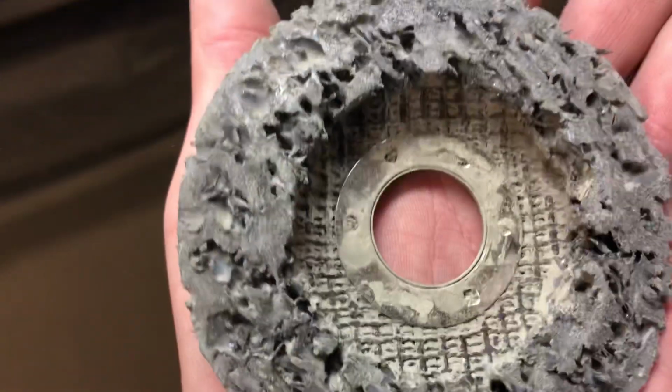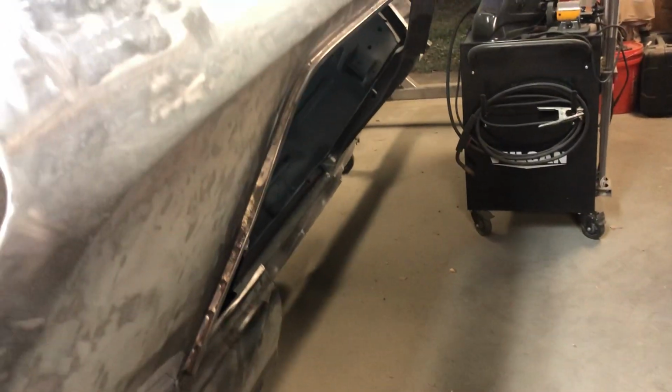So the roof is stripped, minus a couple of little primer areas. We ran out of those paint strippers. These little doohickeys. Ran through about 3 or 4 of them. And then I wire wheeled the rest. And whatever kind of primer they had, I'm not sure what they had on this roof, so I don't know if this is original either. I'm assuming no, because it had a good bit of Bondo on here, and I don't believe that came from factory.